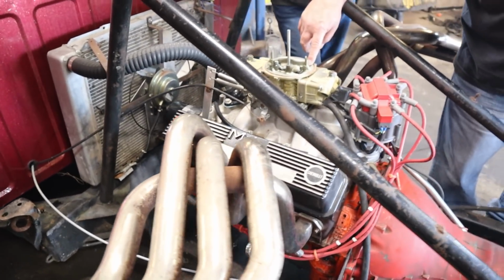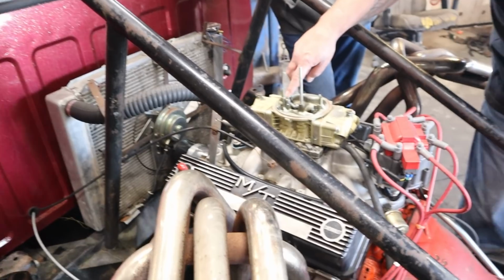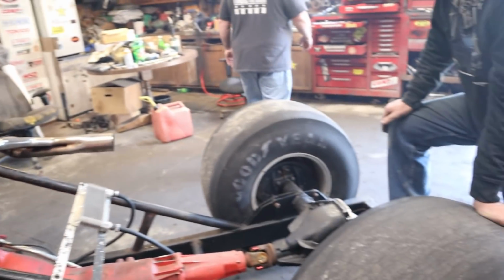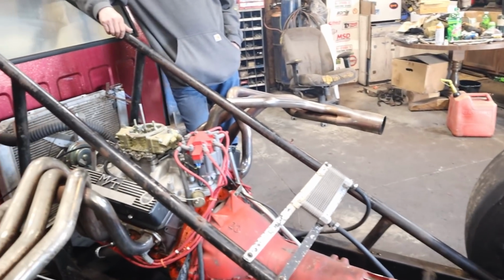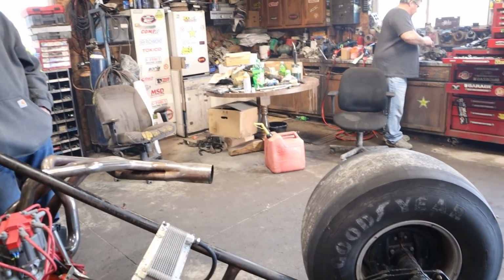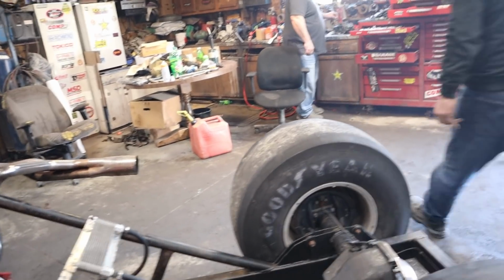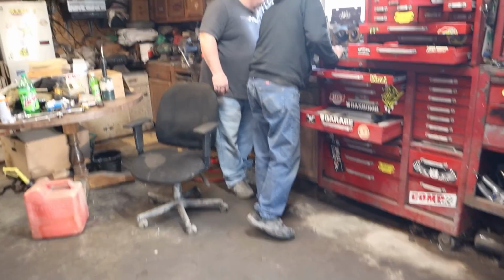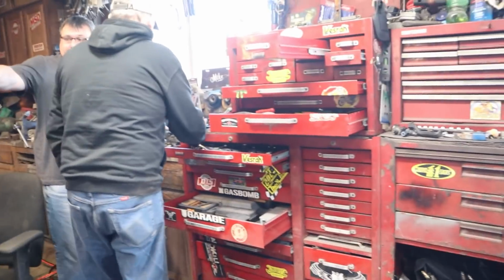And you know, you got the changeable air bleeds, where this old school stuff here, you can't change the air bleeds on these ones. They're just, it is what it is. I've seen guys actually take paper clips and stick them in there and try and get the air fuel mixture down on your idle circuits, because you can't change them out like that one.